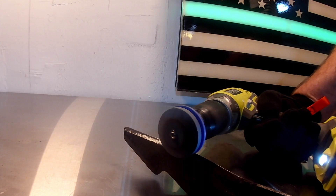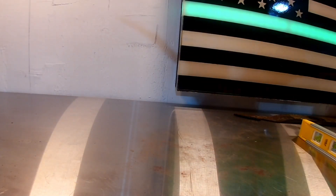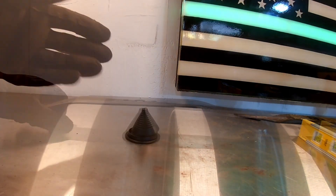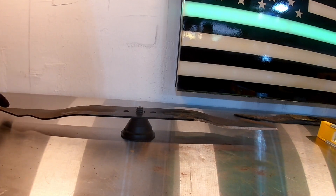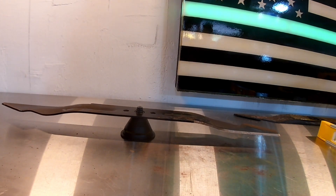Here I'm just removing a little bit more from that side, making sure everything stays nice and sharp. I lift up, grind a little bit more off the back, and then put it back on the balancer. This time we didn't even need to go three passes — and you can see that it's now pretty level. Not bad at all. We're going to go ahead and get it thrown on the lawnmower and also clean up the lawnmower.